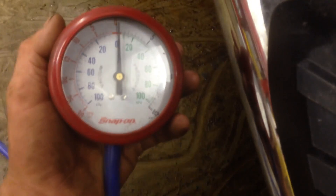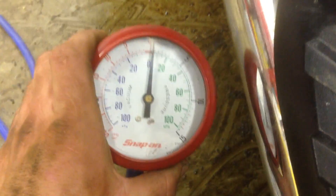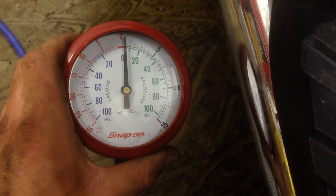When you give it throttle, watch what happens. That is one stopped-up cat. It's plugged up so bad it even blew the line off. That exhaust is just dying to get out of there, and it found the easiest way to get out was to blow this line off. So, another tip of why to use your test tools...